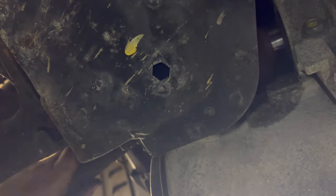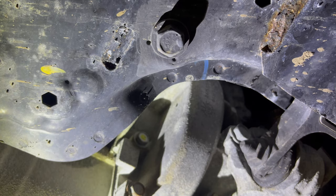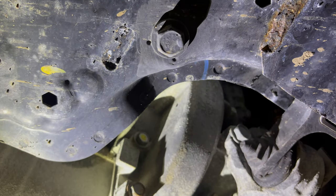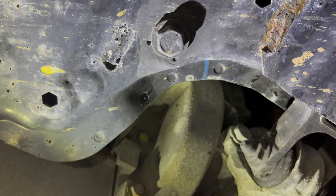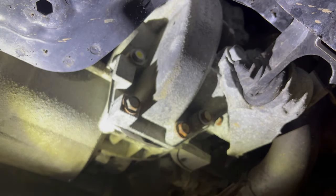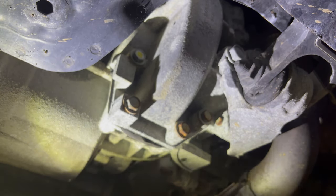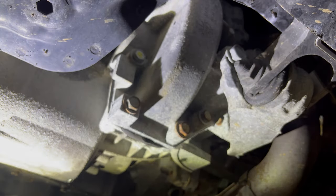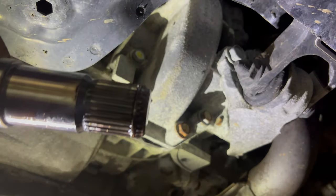Then you're gonna get your pan ready, because when I take it out, it's likely to dribble. I've got my pan pulled up right next to the camera. I don't know if you can see that. But as I bring this out with some gentle but loving force, like that, it looks like it's going to be dry. But you never know when she's going to give, and it won't be anything you did. There we go. I didn't put a lot of pull on that because I didn't want to damage this inner joint. But that is your inner joint.